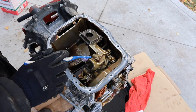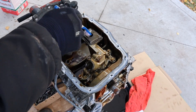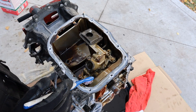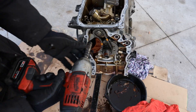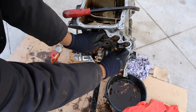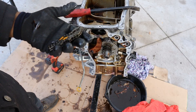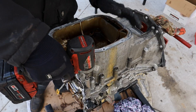Here we've got the oil pump, driven off that chain in the front. The oil pickup tube is pretty clean with no debris in there, so this engine was actually pretty healthy before the head gasket failure. I'm going to remove the 12mm bolts that hold it on, then the 14, and remove the pump. There's also this little gear here — such a tiny, cute little chain. Next up there's a bunch of 12mm bolts going all the way around the upper oil pan.